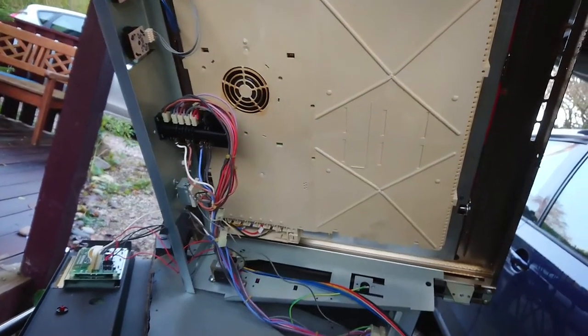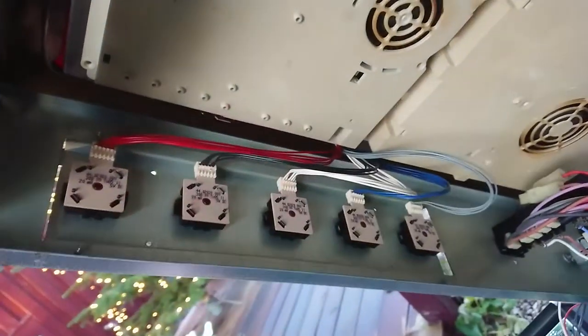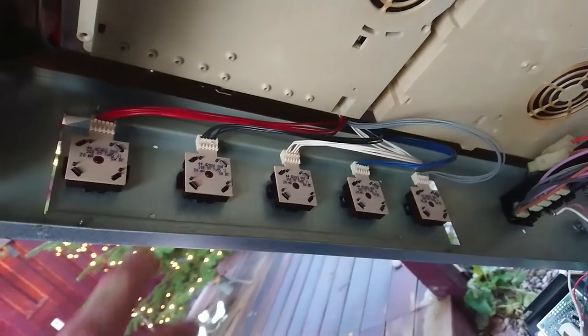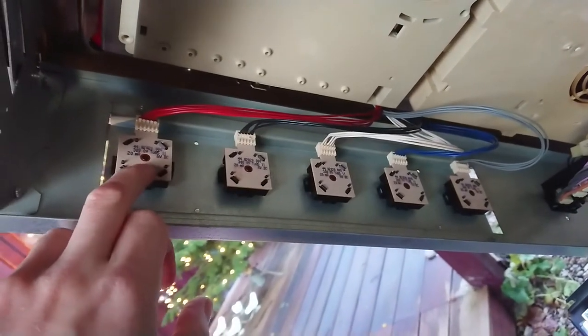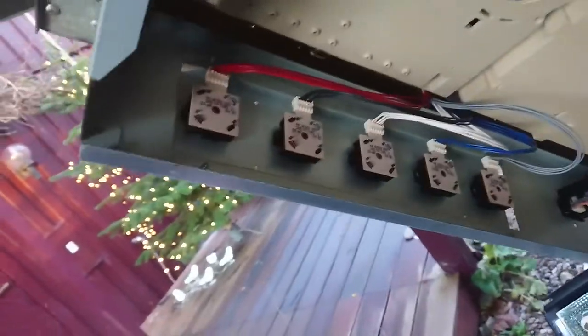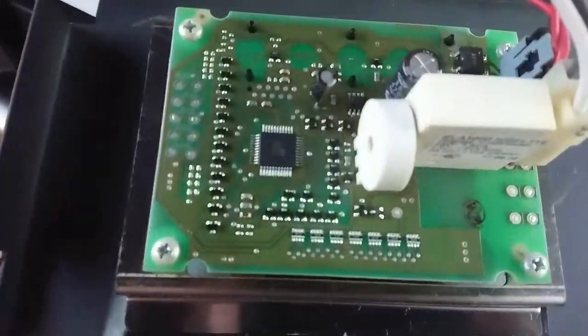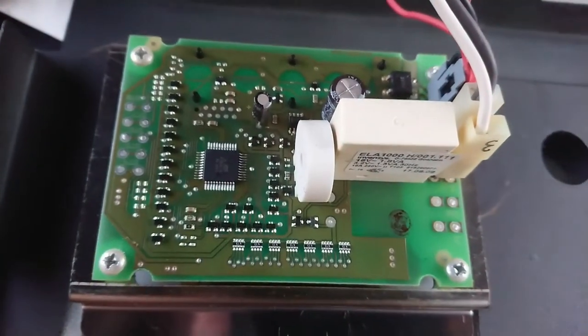The rest of the wiring goes over to the oven timer and digital controls up to the induction section. We can see these are actually 20 milliamp, 5 volt DC encoders, so they are worth keeping. The front clock is actually controlled by an ATmega16.